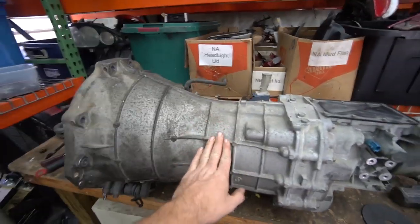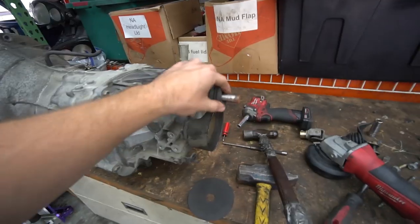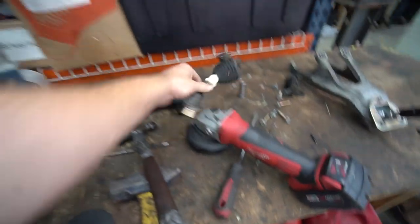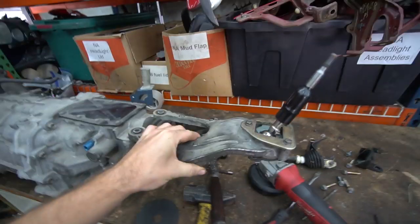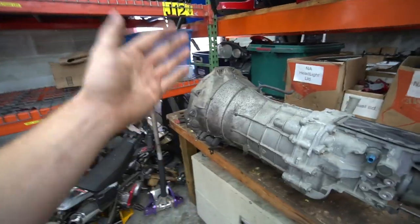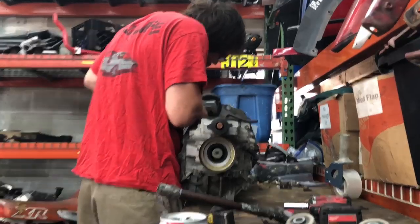We're using a CD09, just like I did in my car, and a Collins adapter plate. We already took the shifter off — there's just a detent pin there that pulls the shifter linkage off. We've got a GK Tech shortened shifter to put on because this puts the shifter location really far back; the GK Tech one ends up right here. We also need to cut the bell housing off to put the Collins adapter plate on to run the 256 bell housing.